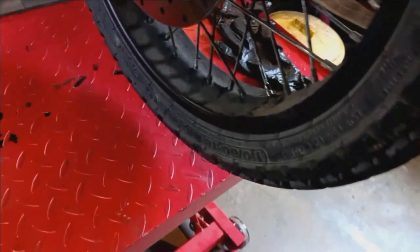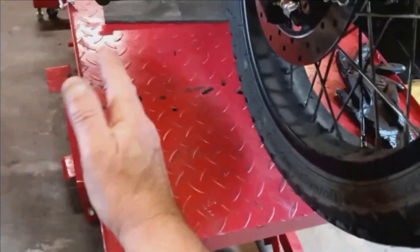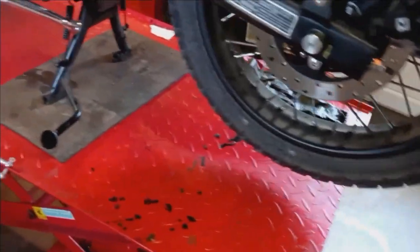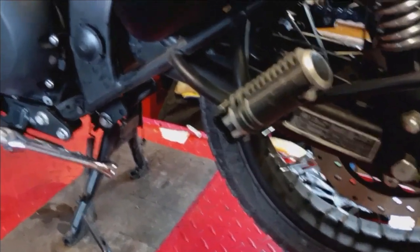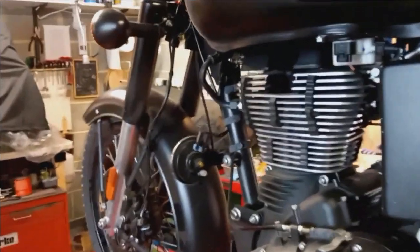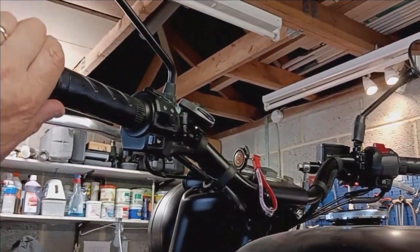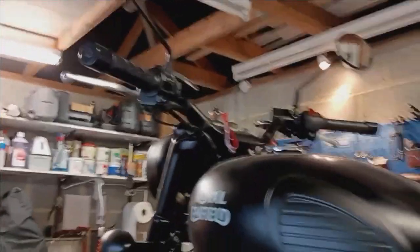I don't think that's very accurate. In any case, it results in the rear wheel being offset to the left. That's how I did it last time, and the bike has tended to pull. If I take my hands off the handlebars, I needed to sit hanging over the left-hand side of the seat to keep the bike balanced, or alternatively push the left-hand handlebar away slightly, and then it would balance upright.